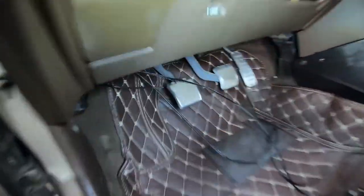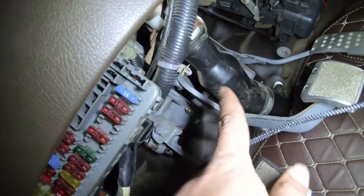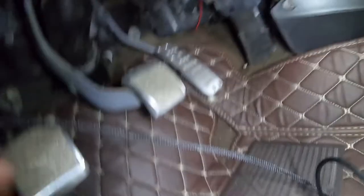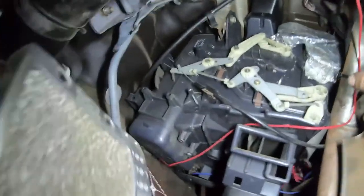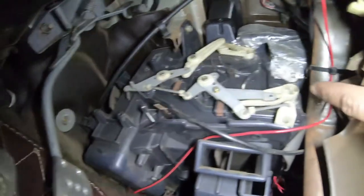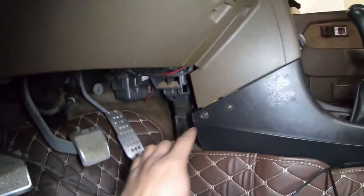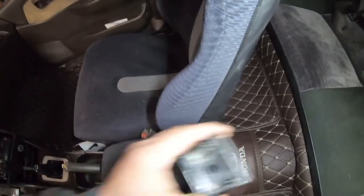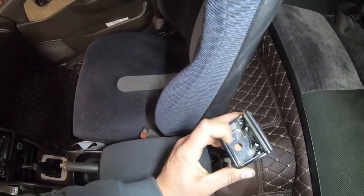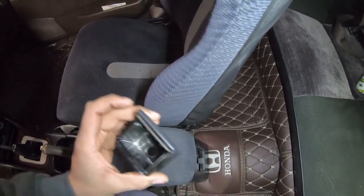So this is the way I'm going to run my kill switch wiring - I'm going to run it all along this loom here. I already have another switch wire zip tied up here, so I'll just zip tie it up to that too. Then I'm going to run it all along the center console all the way back to the ashtray. I'll need to drill out that hole first and get the right size for that.